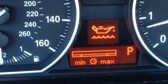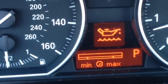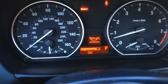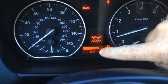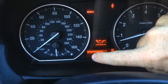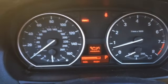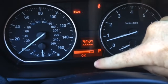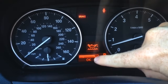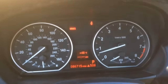The little clock icon is spinning — you can see it right there — and it might take a couple of minutes, especially on a cold start. Okay, it's finished. You can see the bar is about three-quarters of the way up, so it's fine — a tiny bit low but nothing to worry about. If you start getting down to the minimum, you'll need to add oil. Even in the middle I would add a little bit. From one mark to the next is basically one quart. But that's it — that's how you check the oil in a 2006, 2007, and up BMW. Thanks for watching.